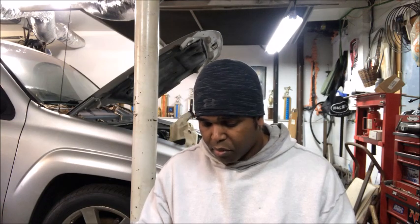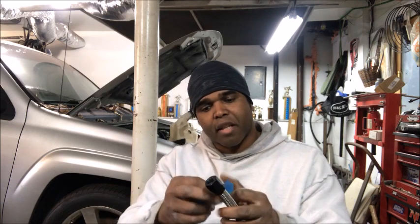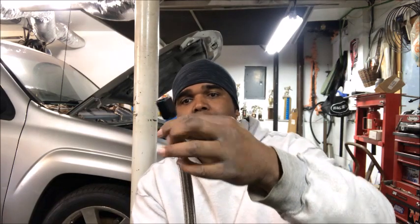I like to get some tape, just like this. Wrap it around a couple of times right on the collar, just like this. This is a good measurement because you don't see any part of the braided hose through the top of the collar here. So once you start going in, if you start seeing it separate, then you may have to do some readjustment.